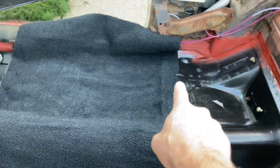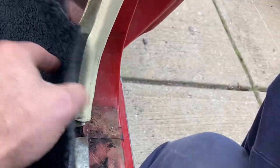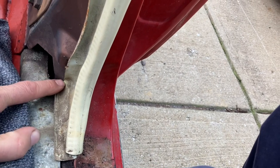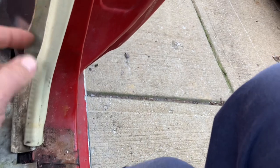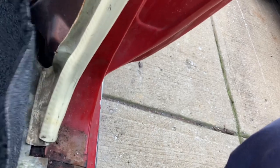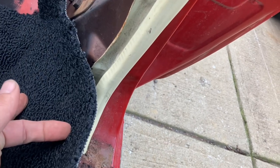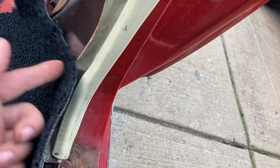Laying the carpet in — you can see the orientation; it doesn't really go underneath the back seat. We'll have to cut around the seat mount here in the front. The areas you really have to be concerned about when cutting the carpet edge is where it meets up here — you don't want to cut it too short or you'll see all that gap. You want the carpet to lay right at the bottom of the vinyl cover. So cut a little at a time. Leave yourself a little extra slack, then trim it back slowly.